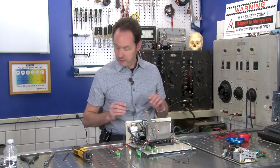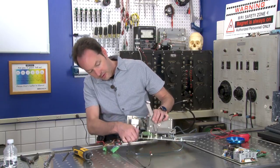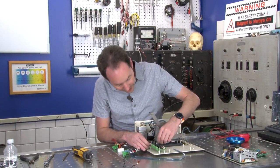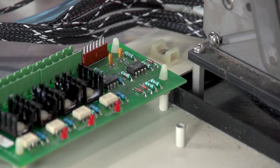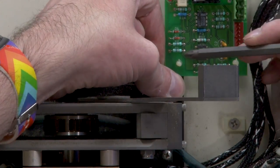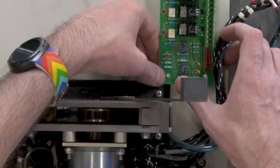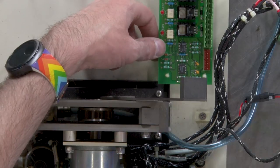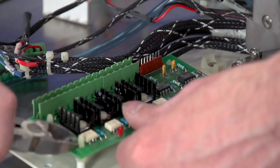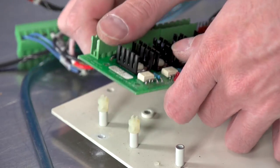We're still not to the cool parts yet. This circuit board is not bolted down on top or bottom — it's just on little plastic standoffs. The nice way to remove it: see that little wing that sticks out? It's flexible. If you push it back, the board pops up. It's a very polite, easy, simple way to do it, and they're reusable. Or the more permanent way is to just cut the standoff right off with dykes, and then the board comes right off.